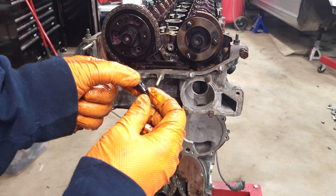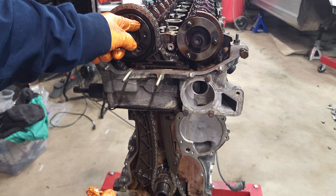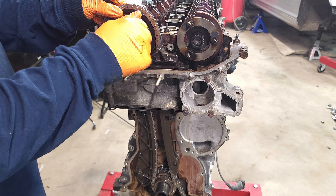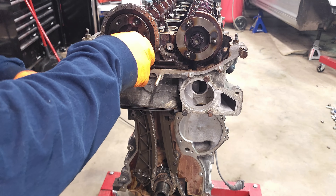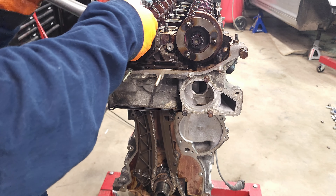Next I'm going to load these three top bolts here with the smaller bolt part hanging out. So next I'm going to put these three studs in right through here — they won't be going through. These three are going to be torqued to 20 newton meters.